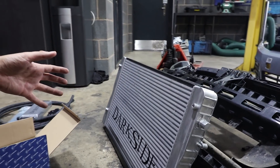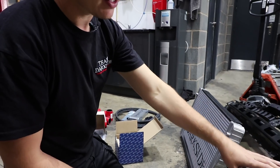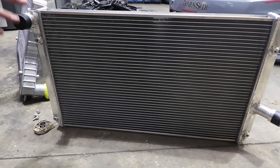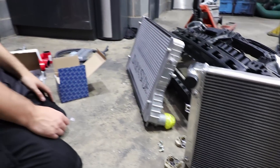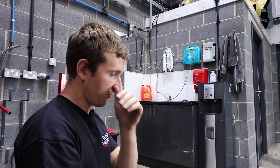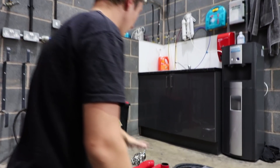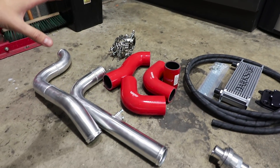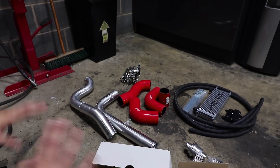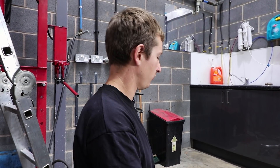It's not as critical for us to have that big intercooler, but you'll see. We've got an aluminium radiator - that's just so you've not got the plastic end caps - and in theory this should just be a straight bolt-on. We're not using any custom fabricated parts; the standard pipework and everything should just go straight on to it, because you don't want to have everything custom really, it's just a pain. So that means we can use our off-the-shelf boost pipe setup. Again, we're not going to need loads of custom stuff - if we have a problem, the standard off-the-shelf components will work.